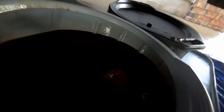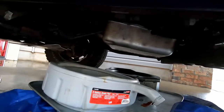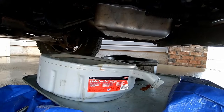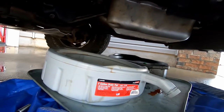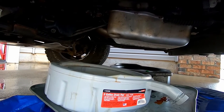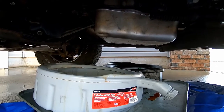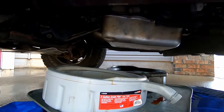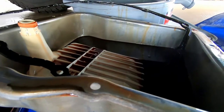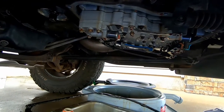You can see we did get the little red filter off - it should be in the bucket there. We do have a drain pan as well as a tarp underneath the truck so that if we do happen to spill anything it doesn't get on the concrete. Now that we've gotten the drain plug as well as that filter off, we can go ahead and drop down the transmission pan. I'm fully expecting there to be fluid still in there. I'm going to put the drain plug back on the pan, just hand-tighten it, so that's not another spot for fluid to leak. We'll get the pan down.